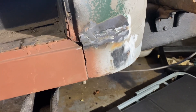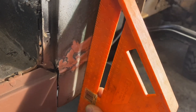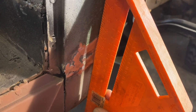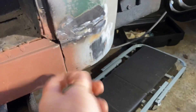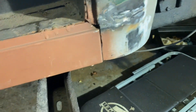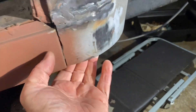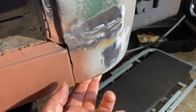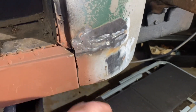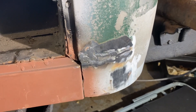I am NOT a body man, but I've gotten these two pieces welded pretty good here - they're pretty flush. I'm just gonna fill in just a little bit, just to worry about this seam. With all the pictures I've seen, this is not welded together. I guess if you want to make a pretty truck, there is supposed to be a lip underneath here. My thought is that's just another place to catch mud and water and crap, so no lip there. But this is a good seam - if some fabulous body man wants to come along after me and make it beautiful, go for it.